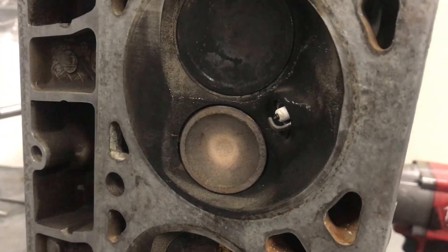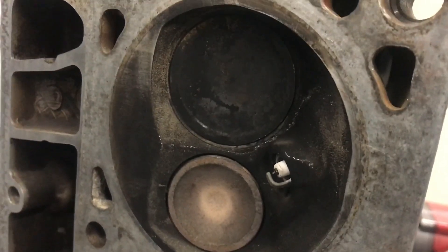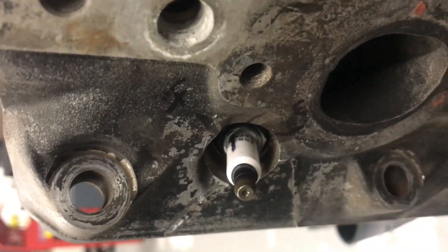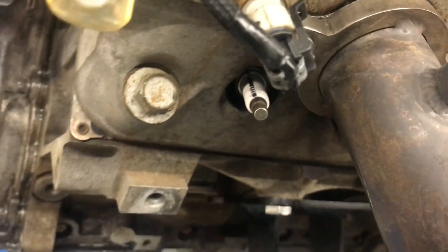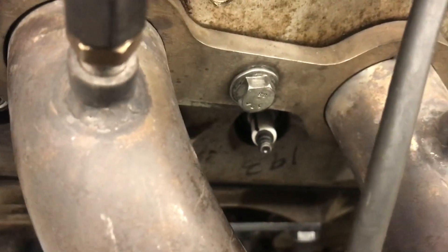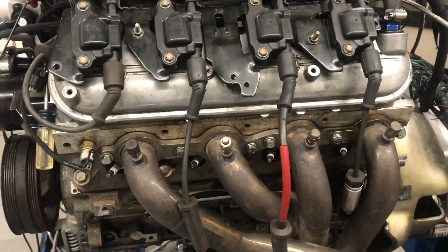Let's check our cylinder head that's removed for reference to verify our spark plug angle. We can see it is open toward the intake valve — we see the notches oriented that way. So that's what we're looking for on the cylinder head installed in the engine. We got them all as close as we could — they're not exact, but most are aiming in the right direction. We've got all of our plugs oriented toward the intake. Now let's go run it.